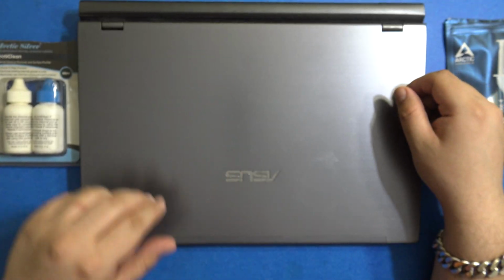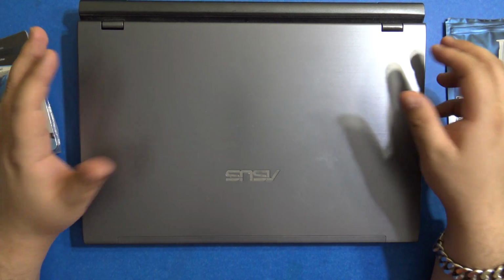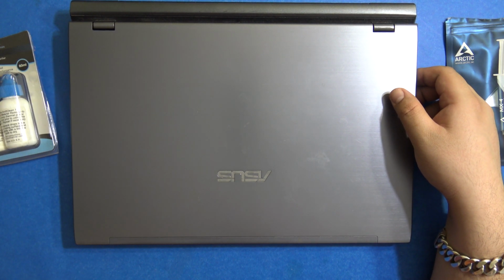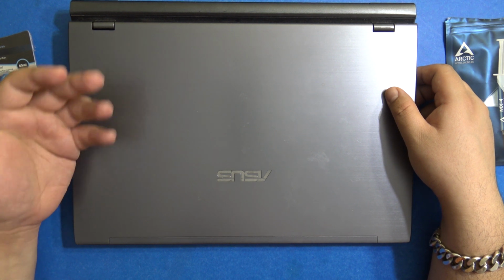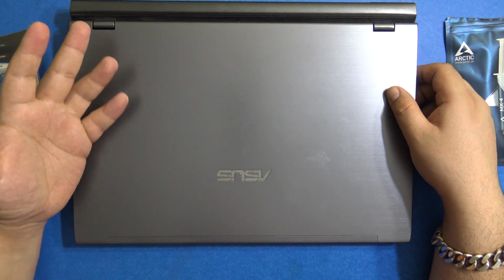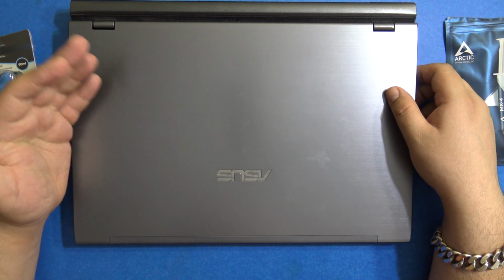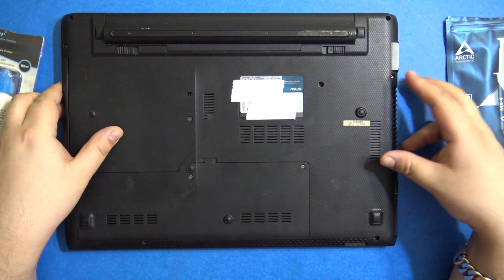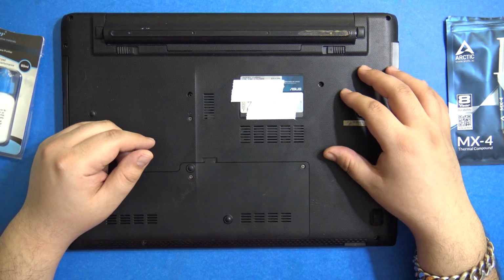In this video I'm going to show you how to fix an overheating laptop. I have this laptop, it's about 7 years old. I think I bought it in 2011 or 12, and it's beginning to heat up a lot and it switches off. I could see the temperatures in Core Temp being very high, and even at idle it's at about 50 plus degrees, and if you play a video or something it jumps up to 60-65. So I'm speculating that the fan either is clogged with a lot of dust over the years, or the thermal paste on the CPU has failed.